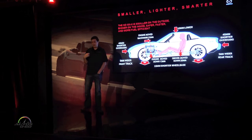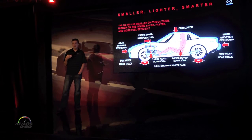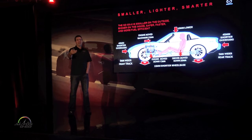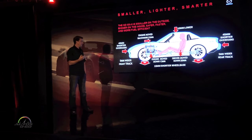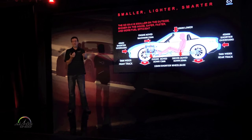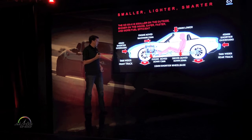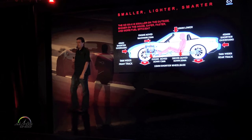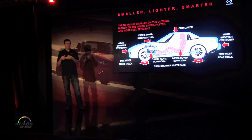We also moved the engine back a little bit farther — 22 millimeters, which isn't that far, because we've already moved it back really far. We started pretty far back on the NA and NB. On the NC I think we moved it back about five inches, so it was a real challenge to get it back any farther. We got the bell housing planted back about 18 millimeters, and this engine is actually a little bit shorter than the old 2-liter. But making that challenge even bigger is the high-pressure fuel pump for direct injection off the back of the engine into the firewall — and we still pulled it back.